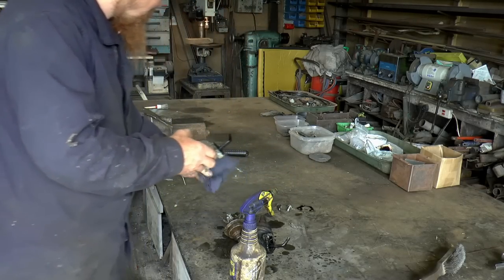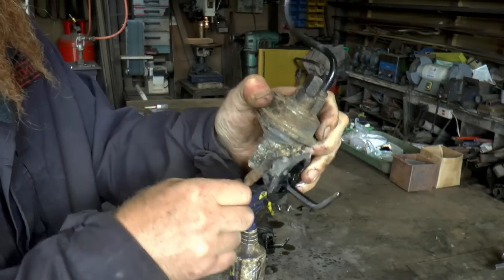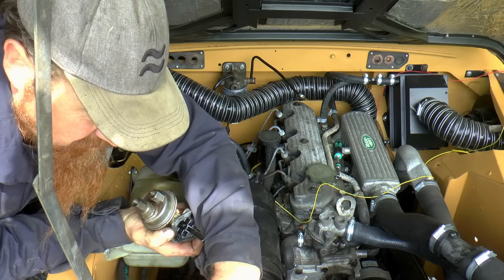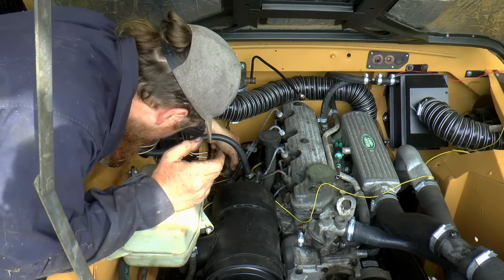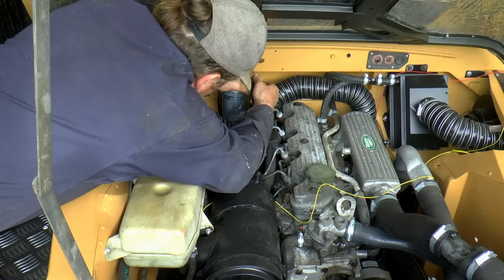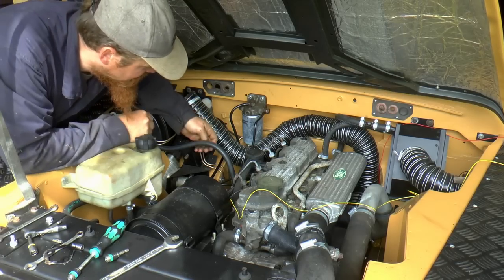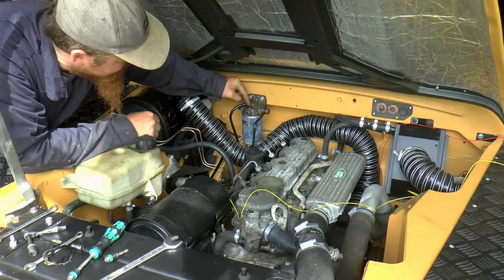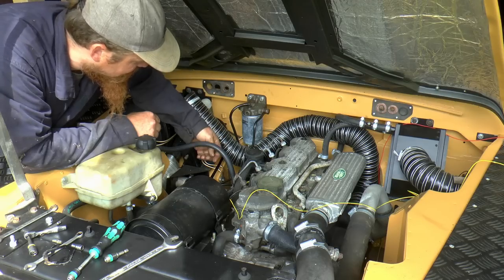This is it now. This is the last of my stock. It's making a pumping noise. Well, we know this one works. So this. Still a gasket on the engine. And now when I pump the replacement pump, we should eventually get diesel to come out through here and a load of frothing, and then when the frothing goes down, that'll be it bled through up to there.